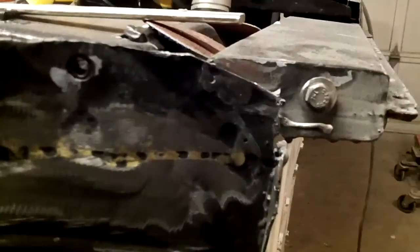I've done a 36 grit scratch on it now. So I'm going to try to throw a little filler on that to even it out a little bit, just so it doesn't look so obviously badly repaired. I'm not going to pull that out. I was pretty content at one point just to cover it with truck bed liner and be done with it, but apparently my mindset's changed on this car since I did that repair. So anyway, that's been being worked on.